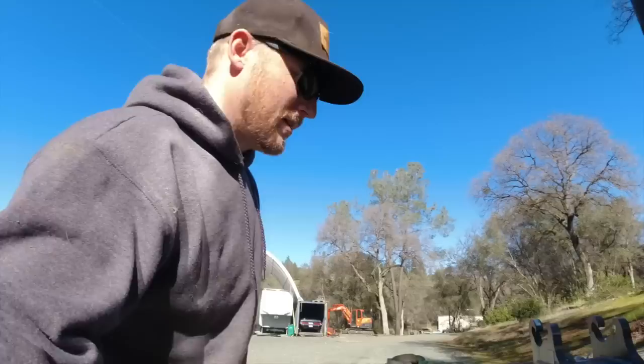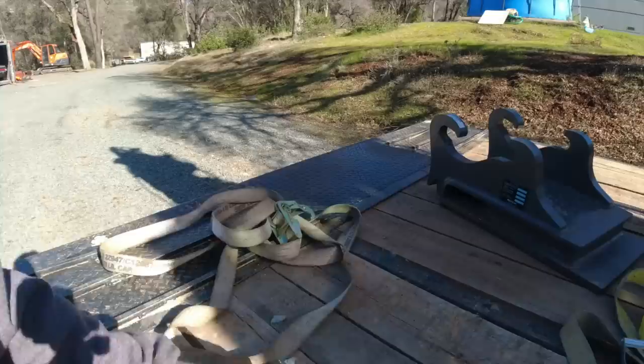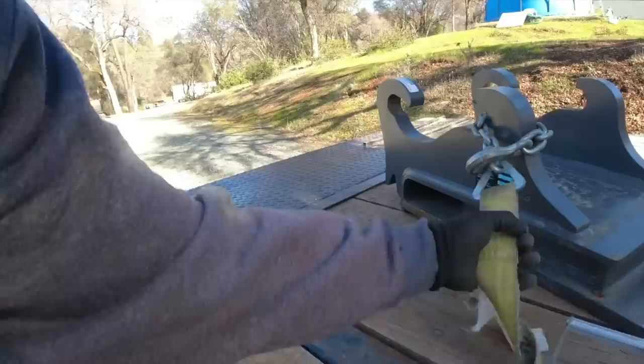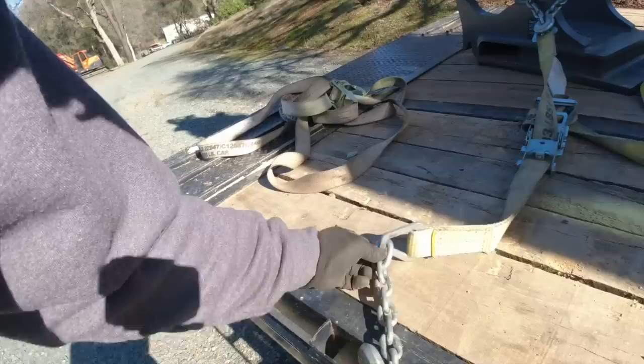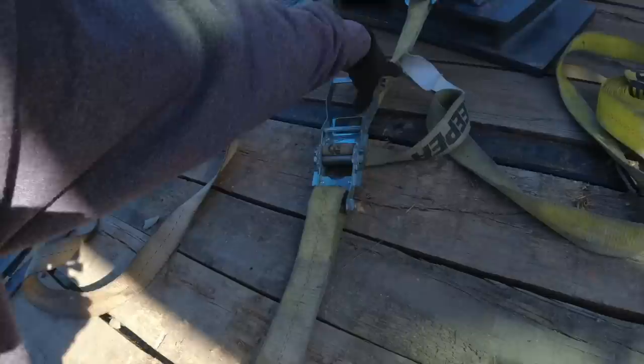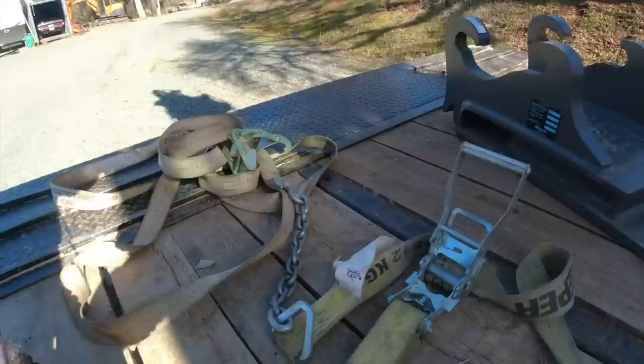Next one - same exact thing, same ballpark rating, same ratchet and everything, but it's got these little chains on the end of it. And no, I'm not using this for tying down a big piece of equipment that weighs 20 plus thousand pounds. I take one of these in situations when you're hauling vehicles - wrapping it around a hard part, you can chain it back to itself, nice and easy, super simple. Same thing on this end - drop it down in there. This is definitely the preferred method of hooking one of these because gravity is holding the chain, so if something breaks here the chain is still kind of hanging on. Give her a couple snugs and this one's done, good to go. That way you're not looping a ratchet strap around a sharp edge like that - that will tear it. That's one good perk of these ones right there.